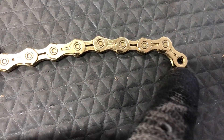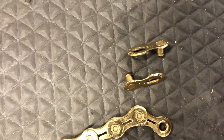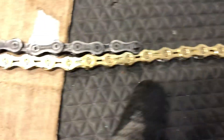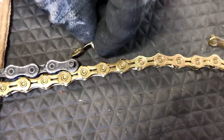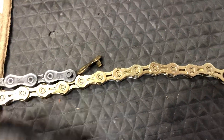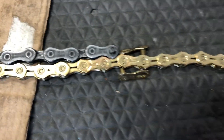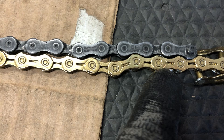I need to break it off here because this chain comes with quick links. You need a hole on each end to stick the quick links in. But if I cut it here, I'll be left with another hole, and the chain will actually grow a full link — so the chain will end up a touch long. So I'm going to go back down to the next valid cut spot.